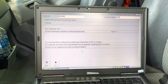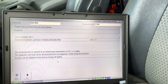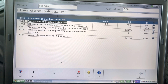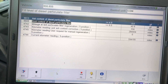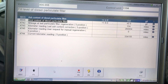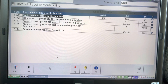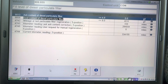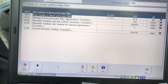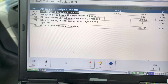The time right now is 3:18, and that's what we're going to track — how long it's going to take. The ash content of the diesel particulate filter is 0.0, which is quite low. But the soot content of the particulate filter is high at 40.9 — that's definitely a problem. It just keeps failing; it's not letting me regenerate, and the reason is definitely due to it being in limp mode. When it's not in limp mode, things work a lot better.